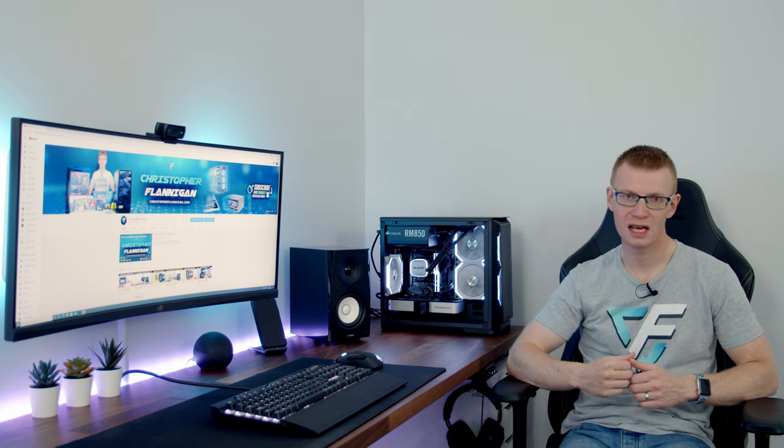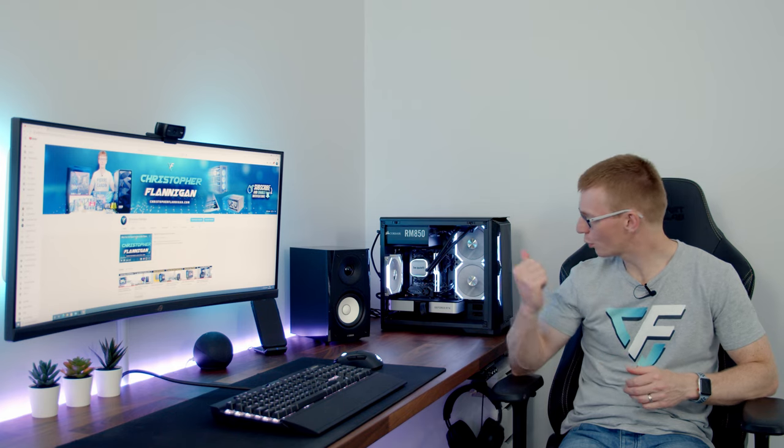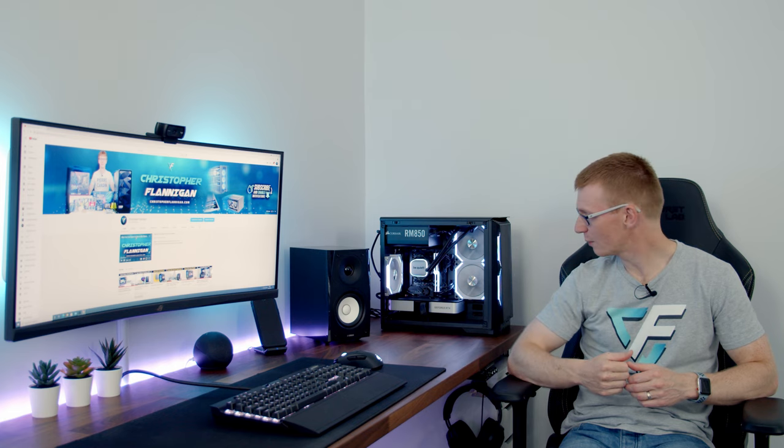Another really key point I would make is I would probably recommend staying away from cable extensions. I did have a white 24 pin cable extension I was thinking about sneaking in, and was actually glad I didn't at the end, because I just about managed to get the back panel on, and with the cable extensions I wouldn't have had any chance. If you're going to go for white cables, and I think white cables would look very good in this build, you would need custom cables rather than cable extensions, because space at the back of the case is actually quite limited.